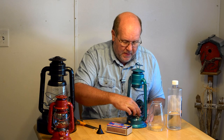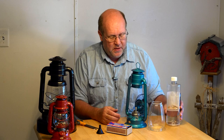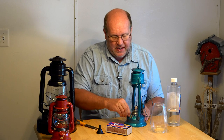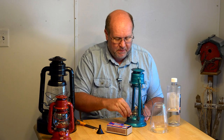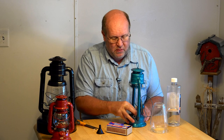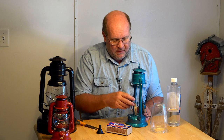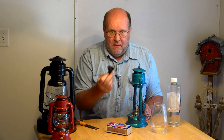Simply replace the burner assembly. If you're uncomfortable with filling one of these with a flammable liquid, you may want to do it with the globe removed and the base plate tipped back — that gets you much better access to the fill opening. Or, if your manufacturer doesn't have the fill cap, you'll need to remove the burner assembly and pour the fuel directly down into the tank. Either way will work if you have the little cap.